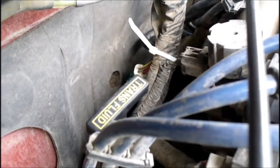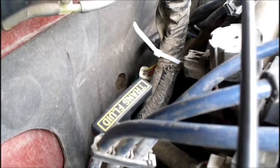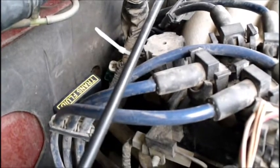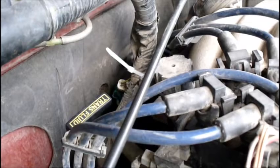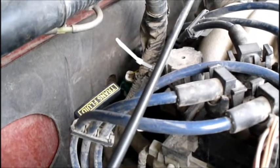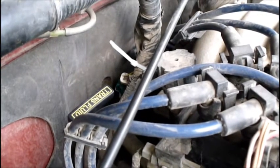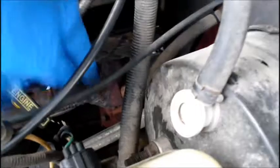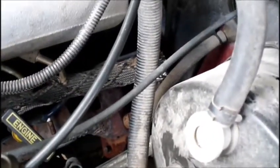Here are a couple of notes before we finish up. You can rent a wrench from places like AutoZone and O'Reilly's — it may or may not fit up in there. This side, which is the driver's side, is really difficult for any kind of wrench to get up in there. The open-end wrench seemed to be the easiest. You can rent them or buy them, but they're like $30, and you might only replace this thing once or twice in the life of the truck. I'm a fairly skinny guy so I was able to get underneath pretty easy, but you may want to jack the truck up on this side to get underneath — you can't really get to it just going down through here; it's just really difficult.